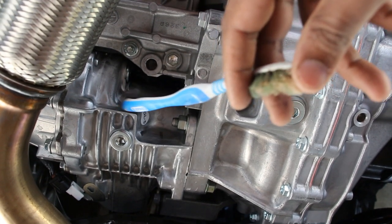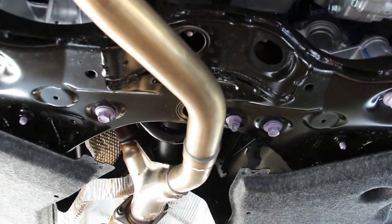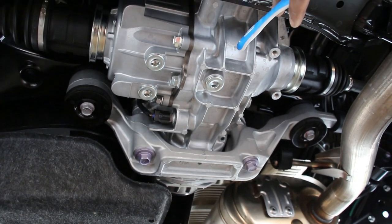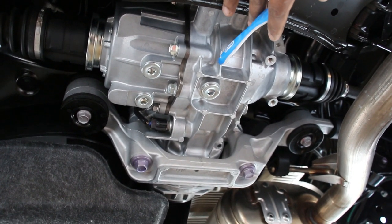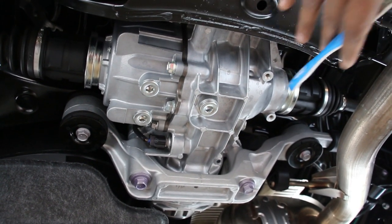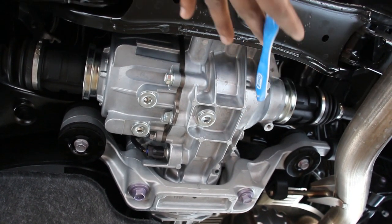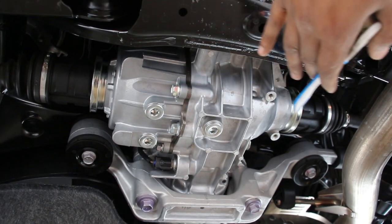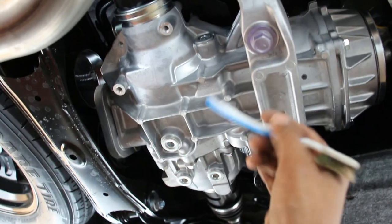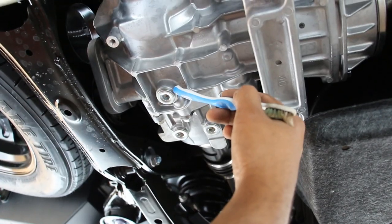The transfer case is going to take some of that power from the front wheels and distribute it along this drive shaft that runs down the length of the vehicle above the exhaust shield. That drive shaft is then going to come to the back here to power this rear differential. What's interesting about this rear differential on the Highlander is it has torque vectoring — which means not only does it bring power to both rear wheels, it can choose which wheel it sends more power to when powering through a corner, helping to rotate the vehicle. It's a little bit better and more complicated than a regular open differential slip-and-grip style system found in many other SUVs. You will have to change the differential fluid in here, so you've got your fill port over here and your drain port located down here.